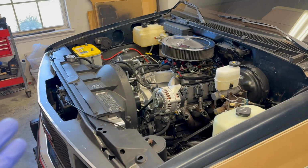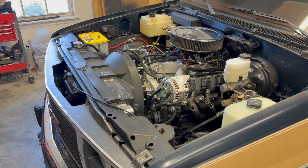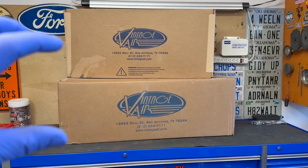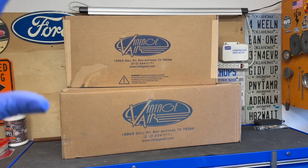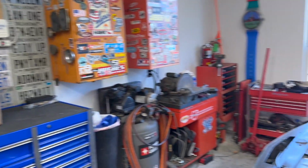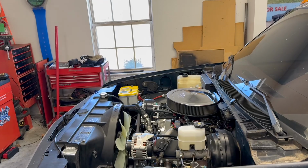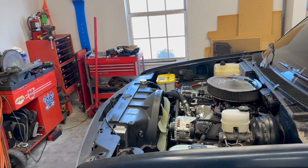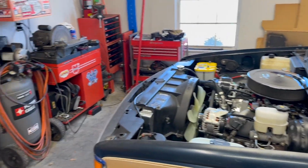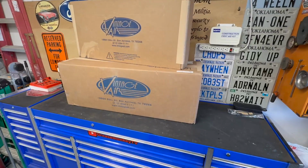And now these systems utilize R134a, which is fairly inexpensive and readily available. The guys at Vintage Air built us a kit with everything except the compressor and sent us the fitting that we need to run on that radial style, aka pancake compressor. Even though he didn't love it and didn't want to do it, I insisted on keeping that. So let's see what we got.